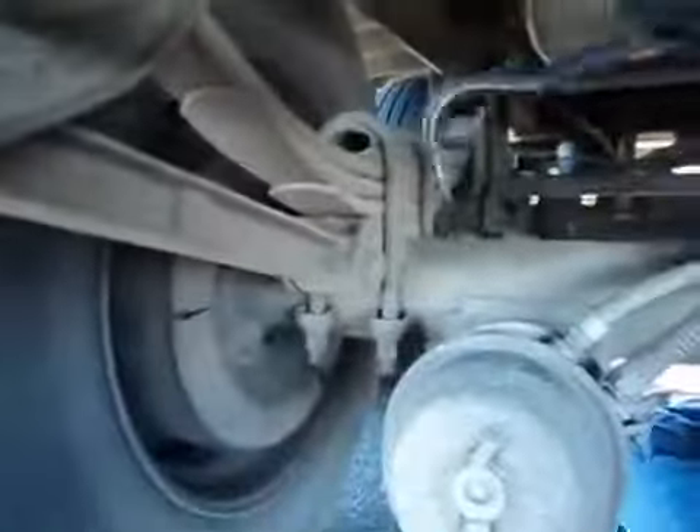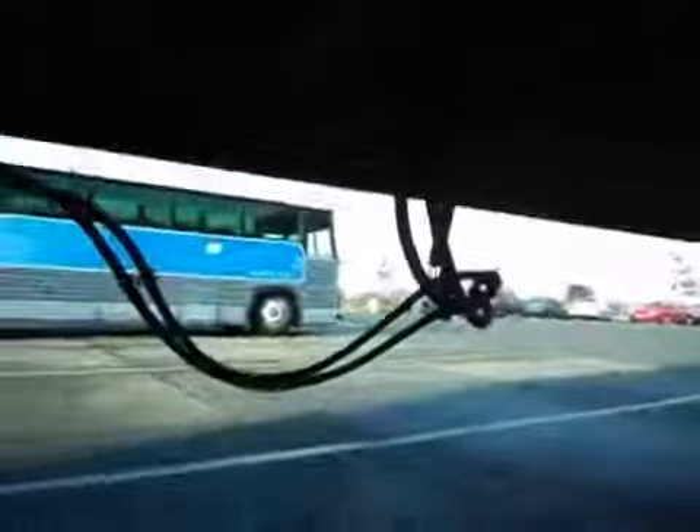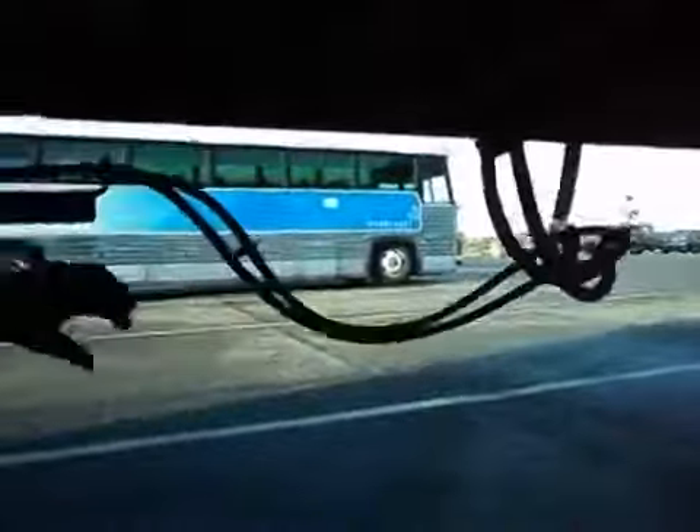Moving forward — I'm going to come around the other side. Leaf springs on the front axle — no cracks, U-bolts are nice and tight, both sides. Then I'm coming out. I look forward — there's no damage to the cross member. My airlines here are tucked up and out of the way, and electrical lines are all tucked up as well.